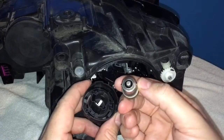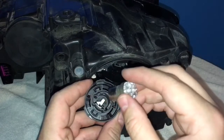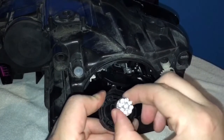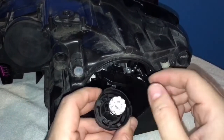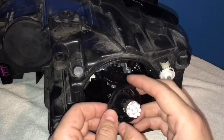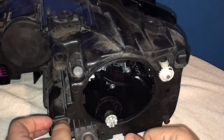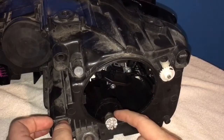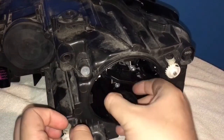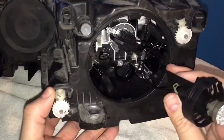The pins are 180-degree straight pins — not offset. You match it with the notches in the socket, put it back in, and turn to the right to install it. Make sure it doesn't come out when you pull it. At this point, leave the daytime running light bulb loosely in place, turn on the car to see if it actually lights up to make sure the bulb is good and installed correctly. Once that's done, put it back in fully using a couple of fingers.